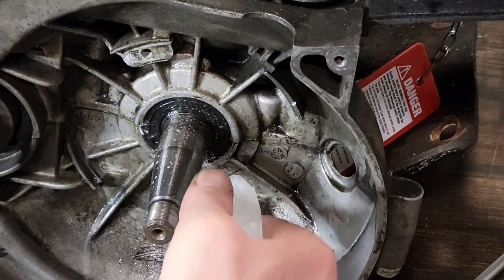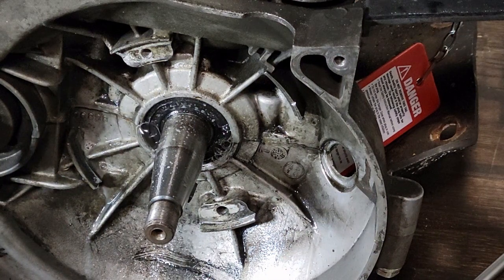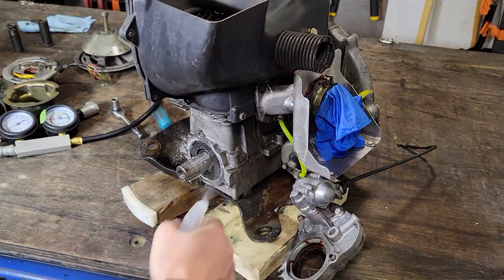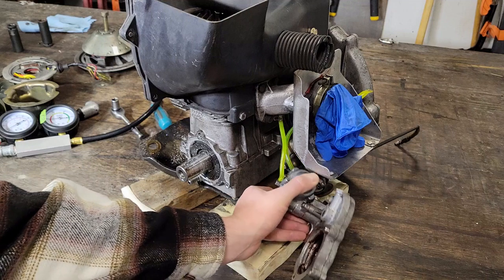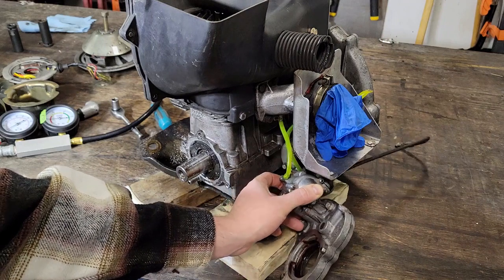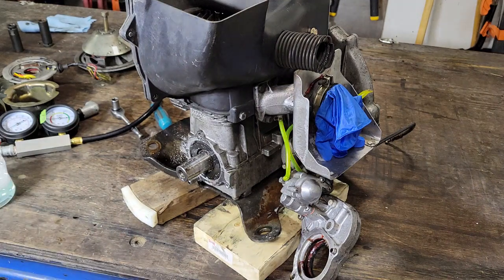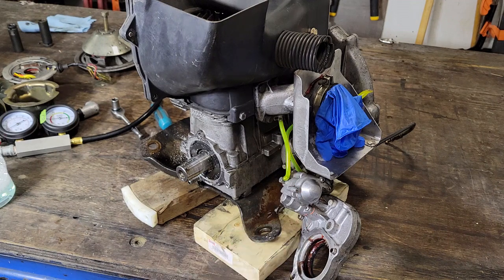Maybe you need to put some sealant around those. Either way, pretty interesting. I figured we should check the PTO side while we're doing this — and that's okay. The air actually pushed the oil out of this oil line when I took it off, and it got a little crooked. I guess you could cap those off too, so I'll just have to make sure I purge the oil pump for the first fire up. Successful leak down test — it showed we had a problem. Unfortunately, it was an unsuccessful seal install, so that'll have to be redone. Thanks for watching.